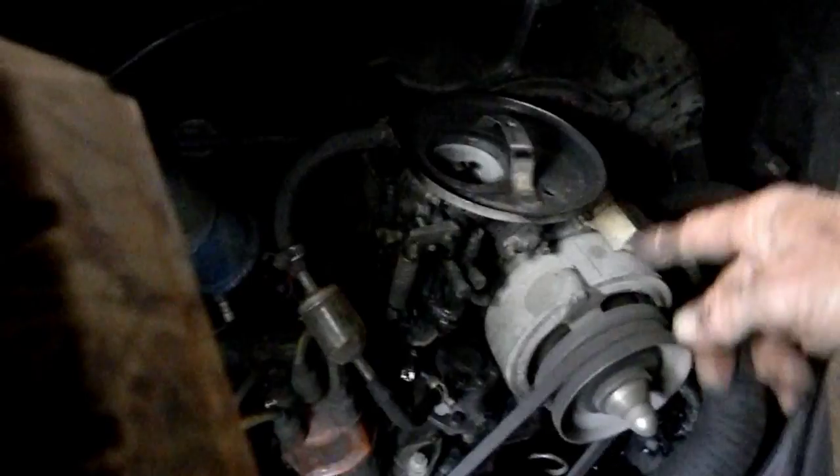See, that carburetor needs rebuilt. The accelerator pump probably has a pinhole in it, so when you grab the throttle, it doesn't catch the idle right away. There's no muffler on it — it just doesn't have the tips on it. But the car has heater boxes — these are the heater boxes. This is what gives you your heat. It's gorgeous.